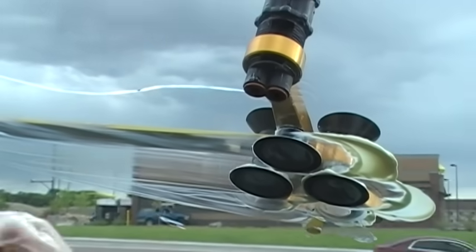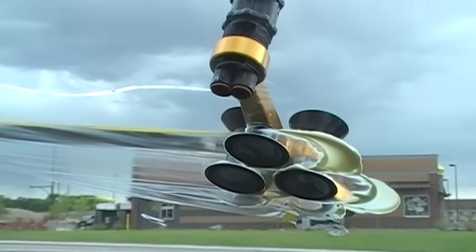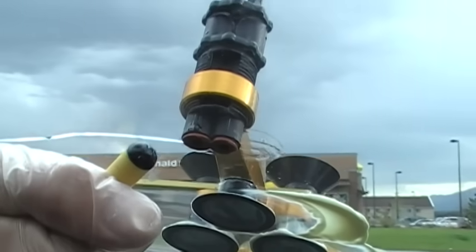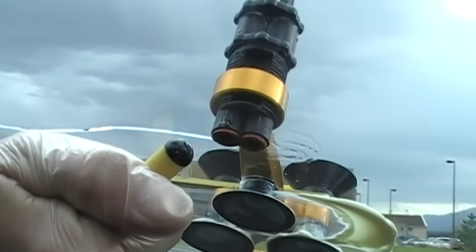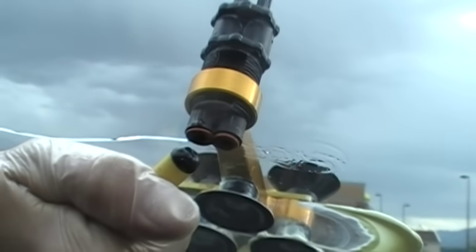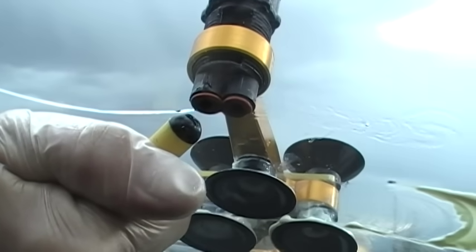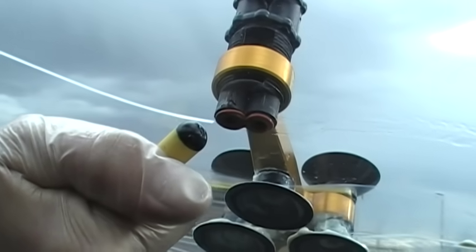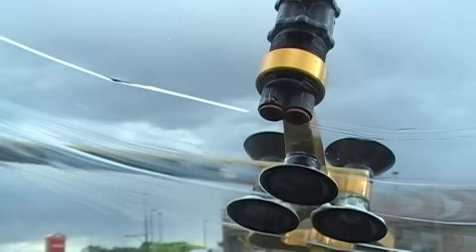Now at the tip, because it is tight, you're going to have to actually get in here and spread the crack, because it's going to be too tight for resin to flow in freely. He's going to be pressing in on it with his hand. It's starting to go, and as you can see, it's starting to fill slightly ahead of the tool.